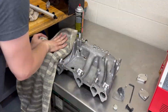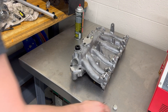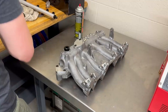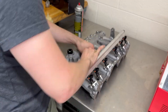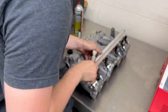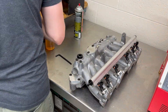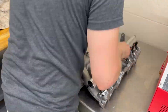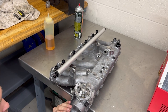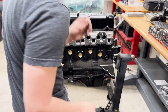So now we're going to be focused on the intake manifold, starting off by installing a couple of block-off plates for the stock emissions control. After that, we're going to be installing my fuel rail with some Bosch 1000cc injectors. Admittedly, that's a little bit overkill for what I need, but it's typically better to have a little bit of headroom on your injector size. Finally, we're going to be installing this 240SX throttle body, which is an upgrade from the stock 50mm throttle body to a 60mm.